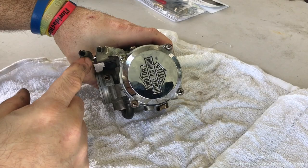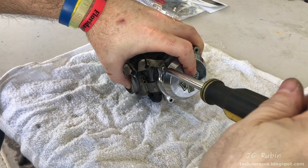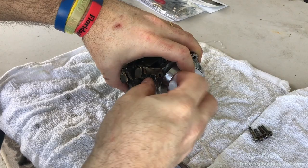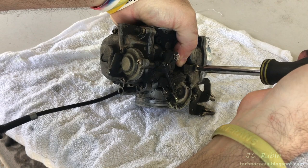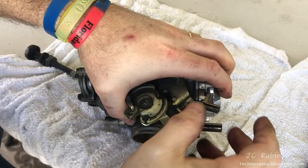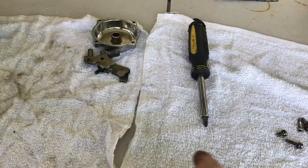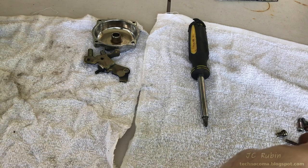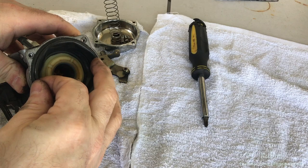We'll start with these four screws that includes the bracket for the throttle cable and idle assembly. Take note that the screw for the bracket is slightly longer than the other three. There's a secondary screw on the side that secures the throttle cable idle screw bracket assembly — we'll remove that now, then take the bracket off and release the cover along with the spring behind it. Be sure that as you work, all the parts and screws are sorted into logical piles.